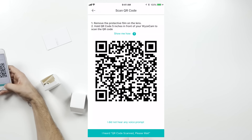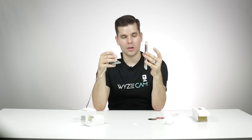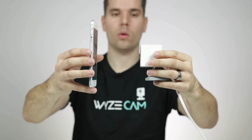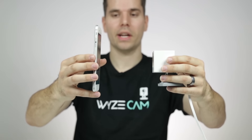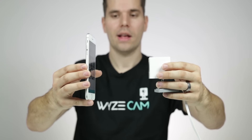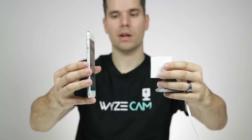Once you've entered that in, tap the button to get a QR code. Now you've got to scan this QR code with the camera — hold your Wyze Cam about 5 inches away from the QR code. After it scans, you'll hear it say "QR code scanned, please wait." If it doesn't work right away, you can move it closer or farther away. Try to adjust the distance between the phone and the camera. If it's still not working, try tilting your phone to make sure there are no light reflections on the screen, as those can block the QR code from being scanned.